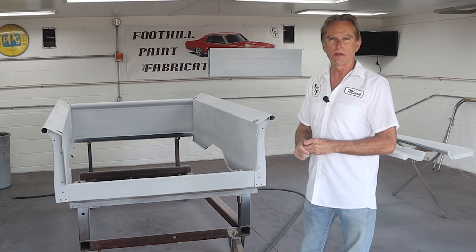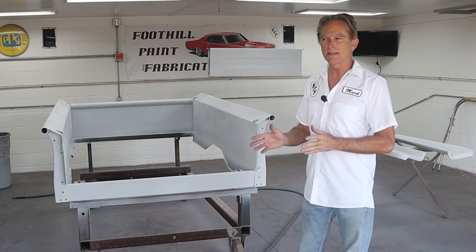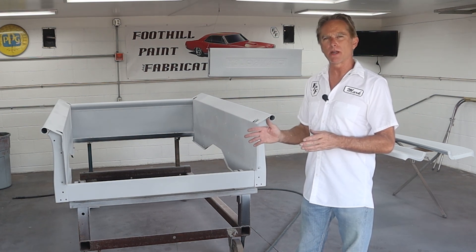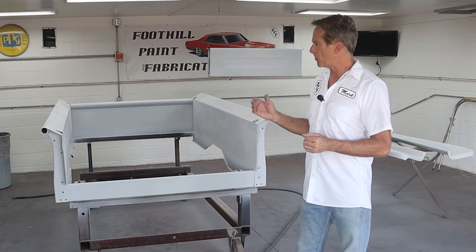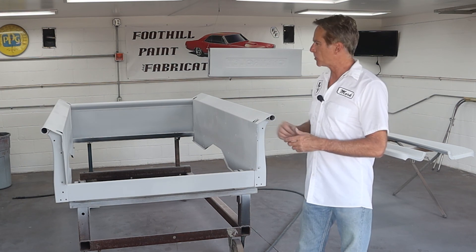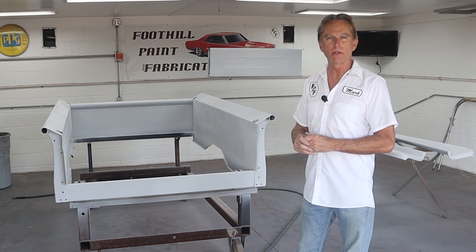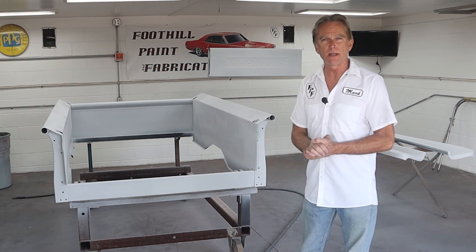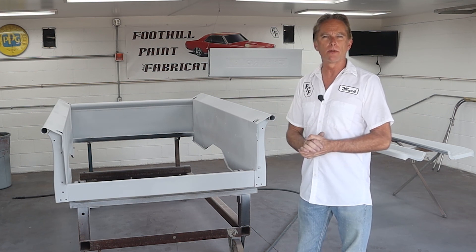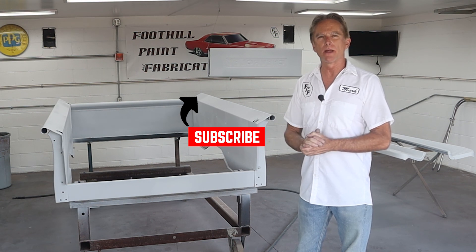Now that 1.7 tip on that new gun — I'm not happy with it. It took too much air to atomize and there was a lot of paint on the ground from overspray. I'll be using a 1.4 from now on and will test that gun again with polyprime using the 1.4 millimeter tip to see how it works. But this is all ready to go — we're going to do some sanding on it next and get it ready for color. Thanks for joining me here at Foothill Paint Fabrication. Don't forget to hit the like and subscribe button and mash that bell icon so you get notifications whenever I release a new video.